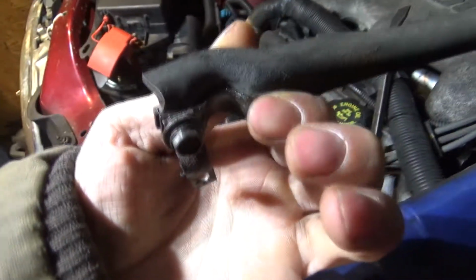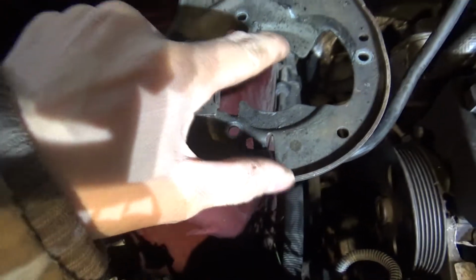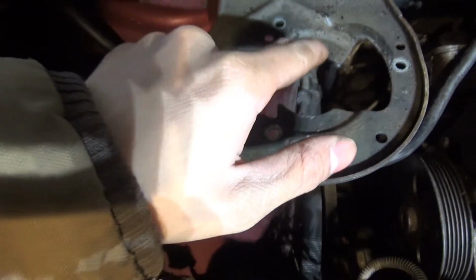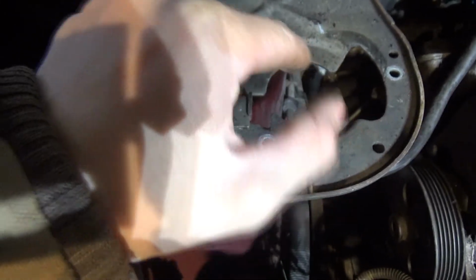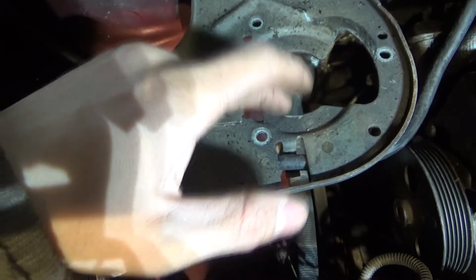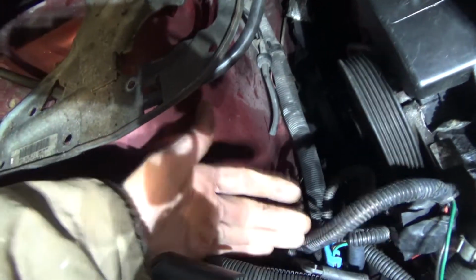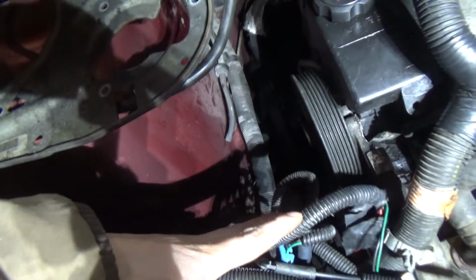It's a little easier. Pull out one bolt fully, loosen up the second bolt, slide your wiper arm right out, then figure out how to get the center bolt of the mechanism out. I used my electric impact. Those are T30s. Take out your 3 T30s on the motor, pop your motor out, disconnect your harness, then get your water bottle out of the way. That's why you have to take the motor out, so you can get your water bottle out of the way.